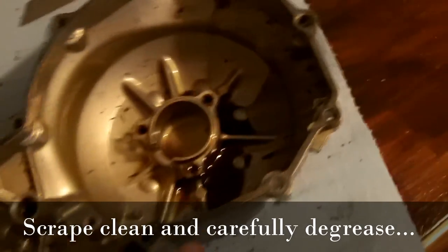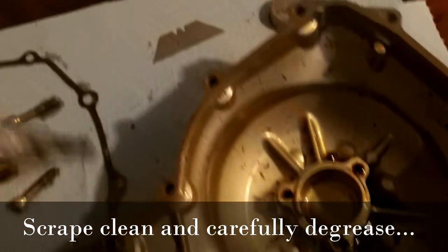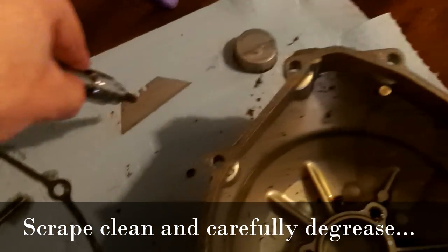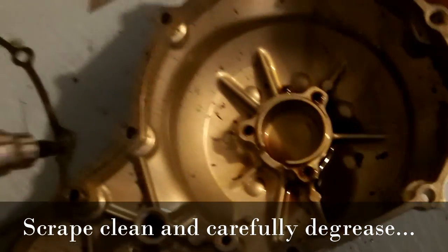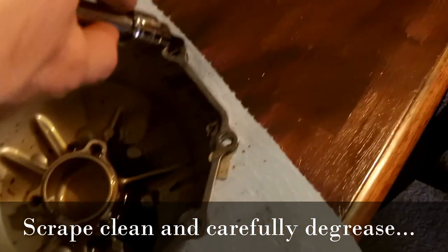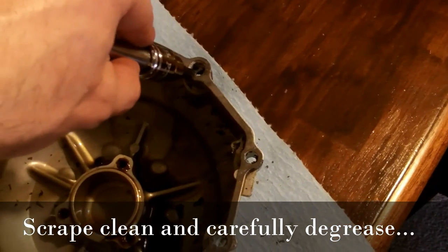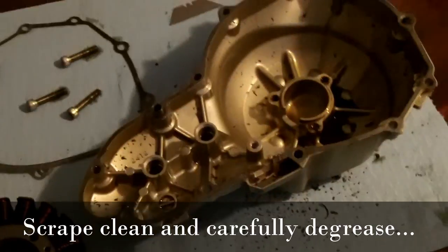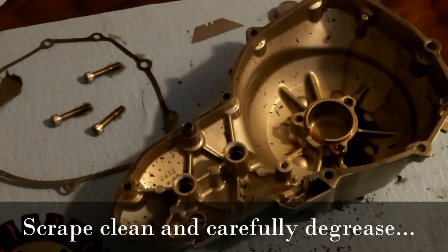Here's the stator that came out. To clean this surface I've been going over it with a piece of plastic, a bottle cap, just scraping away, then using a razor blade for the little corners. There's going to be a pin and a dowel here, and another dowel here — one is still on the bike. I have to do the same surface prep to the mating surface on the bike as well.